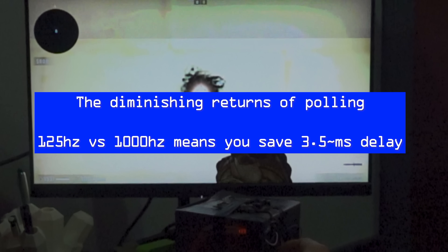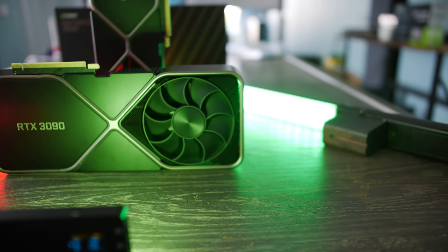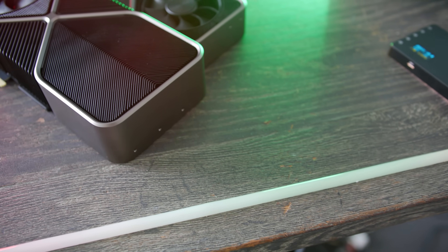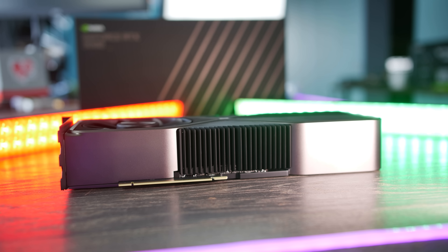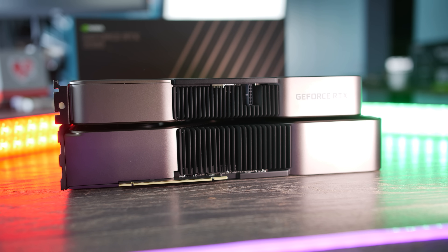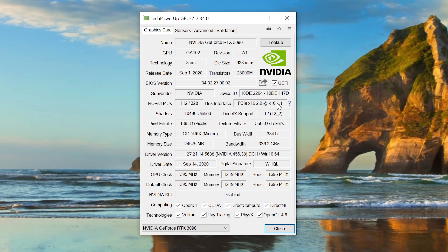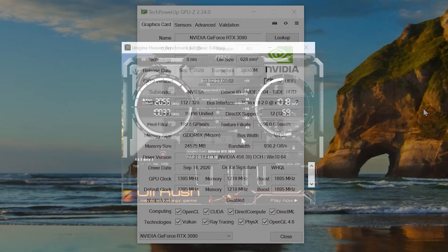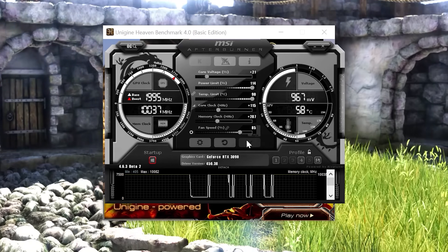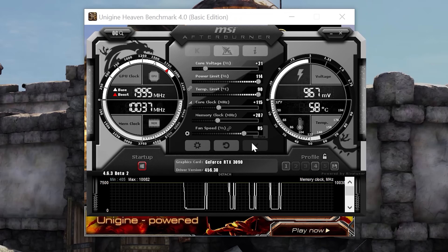Some polls will hit at the start of the wave and some at the very end, hence why it averages out. With RTX 3090s, if you want to put them in SLI and overclock on Gen 3 X8 slots, it's going to be absolutely fine, though your wallet might not be. These results were ultimately a big surprise — I thought the RTX 3090 would require a bit more bandwidth, but the numbers and testing always paint the biggest picture. Though keep in mind, even if you won't need to worry about PCIe bandwidth for gaming for years to come on a Gen 3 X16 motherboard, a revolutionary breakthrough in graphics processing might just have you buying a new motherboard with the latest PCIe Gen 6.9.